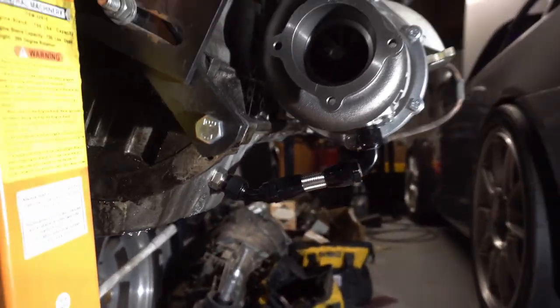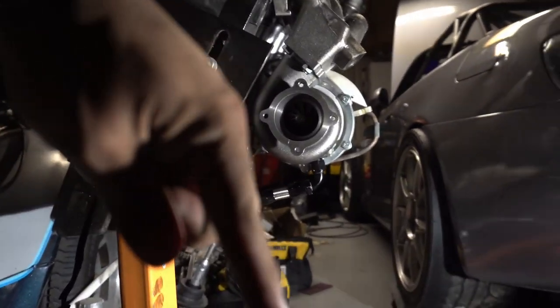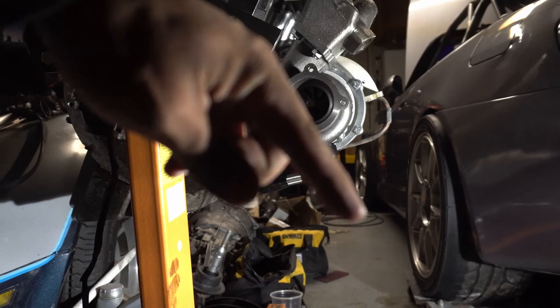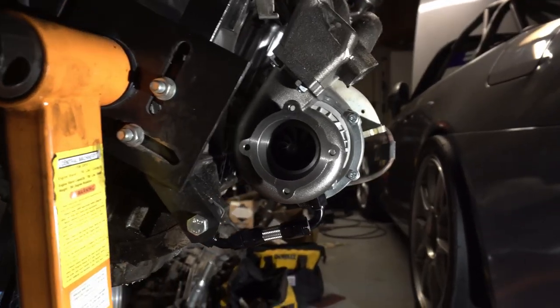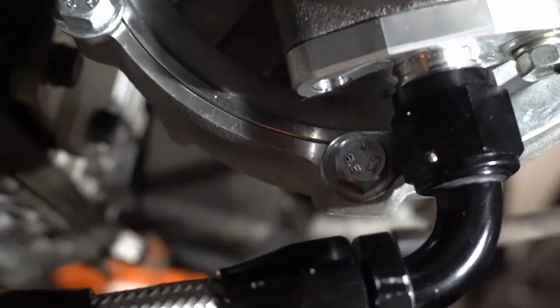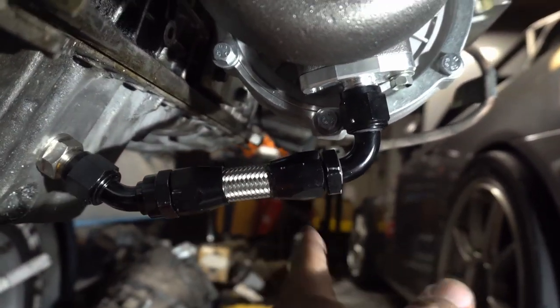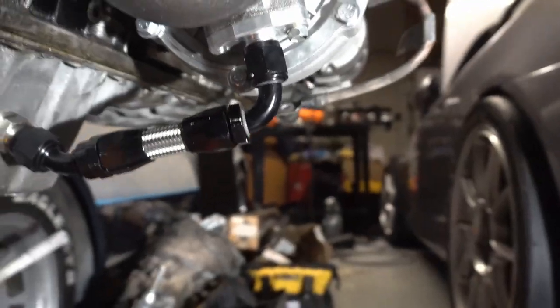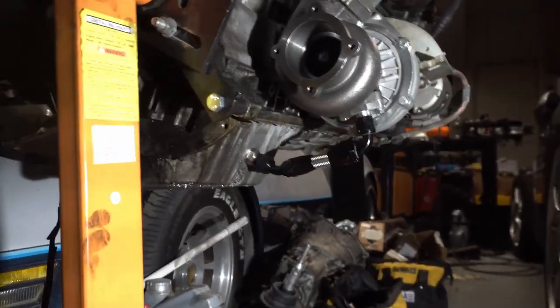The return line may be a little bit too long because it puts the turbo at a bit more of an angle than I originally intended. But the benefit is it actually clocks the compressor at the perfect spot. I couldn't do that originally because a bolt was in the way and the AN fitting would interfere. It does put it at a really nice position though — I may just keep it.